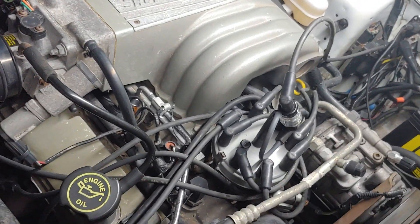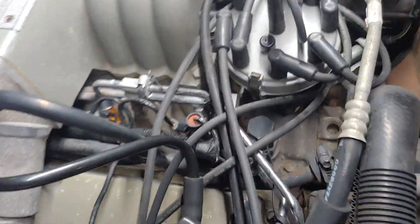So we're going to go down to an injector. On a 5 liter, to give you some orientation here, the first two injectors on the passenger side — injectors number 1 and 2 — are the only ones that are really very accessible. On this car, injector number 2, right here in front of the throttle body area, is the most accessible.